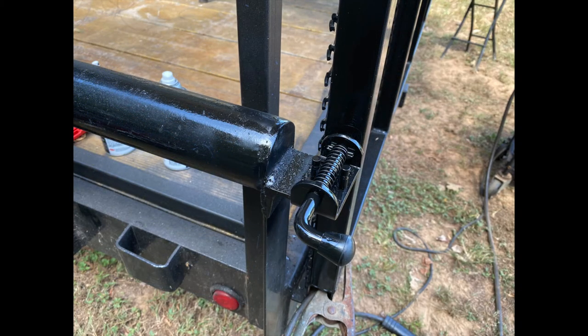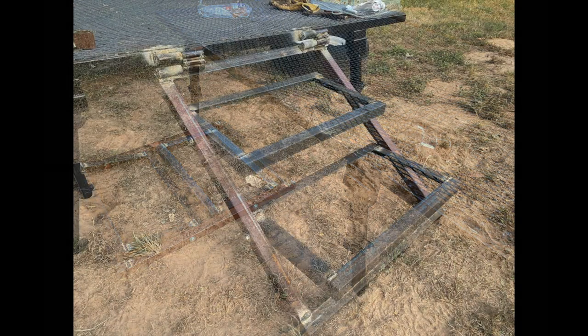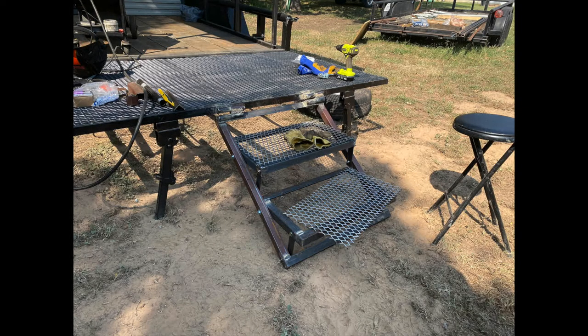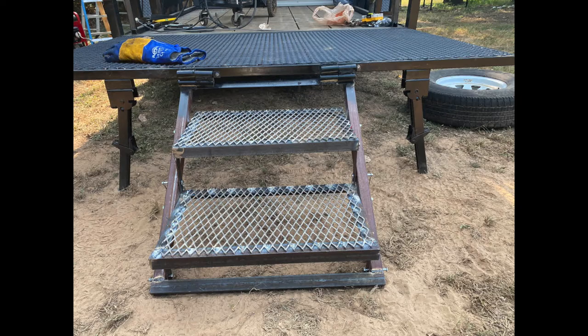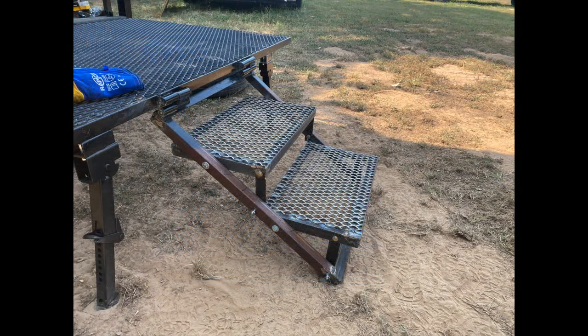I got my spring-loaded latches for the gate to make it easier to get up and down. I do plan to come back and put a gate mechanism to help lower it. There's a shot of the stabilizer jacks and the steps I built, which were a bit of a chore to engineer — I needed something that would fold inside the gate, not on the outside, and small enough not to interfere with my barbecue pits. These have pins I can pull so the steps lay almost flat inside the frame and fold over to the inside.